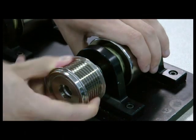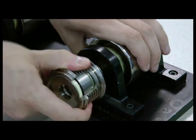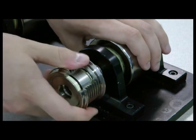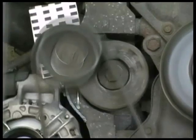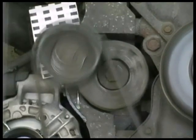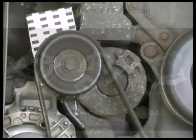Just like the OAP, the OAD will rotate freely in the overrun direction. However, it will engage softly with a spring feel in the drive direction. It is this patented internal steel spring that absorbs the rotational engine vibrations at the alternator. Absorbing this vibration will allow the belt tensioner to remain calm on the newer, more fuel-efficient engines.